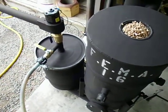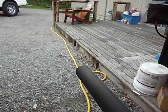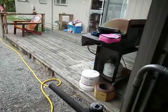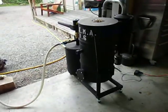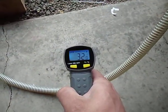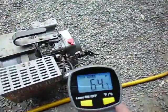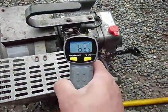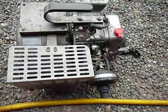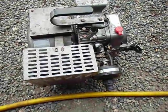The gasifier has been running for probably about 10 minutes. It's up to temp — you won't be able to see the flame, but it is burning. I'll grab my little laser thermometer here. We got it turned on: 64 degrees, just ambient temperature. Now I'll come over here and shoot the head, just to show you that this thing is completely and totally cold. You can see the little laser by the spark plug there — 63 degrees. So that shows you the generator is completely cold, the same temperature as ambient temperature outside.